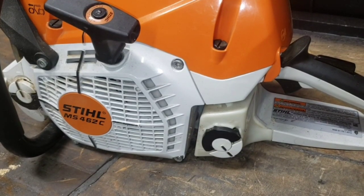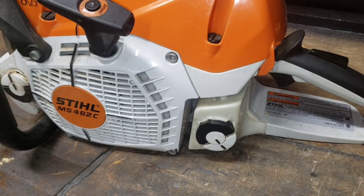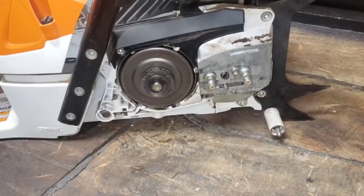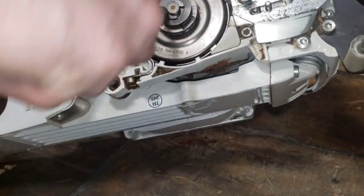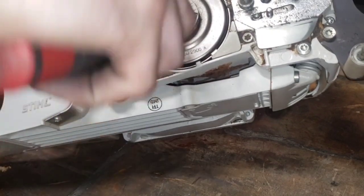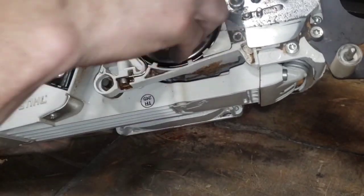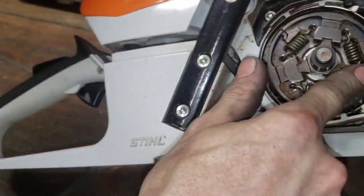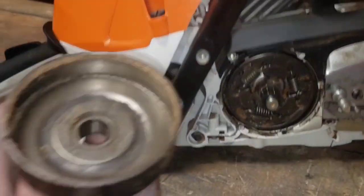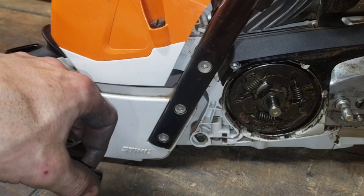If I had to give my theory, I would say it was defective, because the clutch was completely glazed over. They get really hot, they get purple, and I'll show you. This has about two tanks run through it after putting a different clutch in it and you can still see it got a little bit hot, but the problem has gone away. This is a new clutch - clutch drum - and when I say clutch it's the whole clutch assembly.